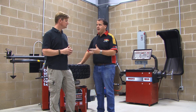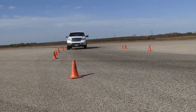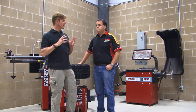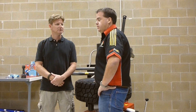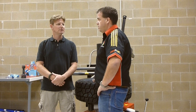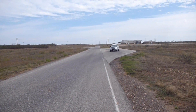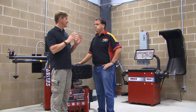The dry handling course is a 1.3-mile, 12-turn course that dynamically stresses the tire differently than the slalom — asking it to brake while turning, accelerate while turning, and transition in new ways. To see the biggest variance between products, Ryan suggests positioning at the exit of the emergency lane change — the point where the tire is under the most stress.